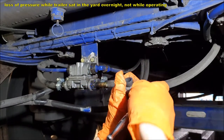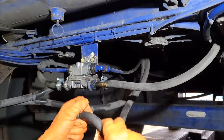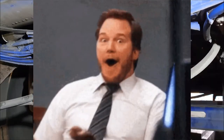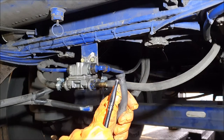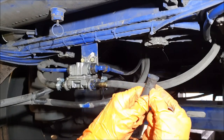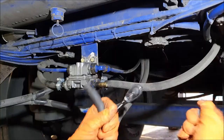Come down here. Don't know where these were done, but whoever put these back on over-tightened these hose clamps. If you pinch the pipe you will damage it. See how it's all damaged around here. We're going to snip this off, replace it, and put a fresh hose clamp on it.